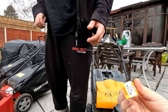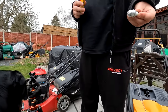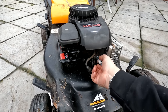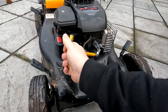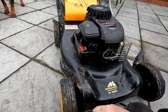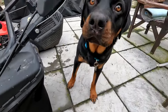B2LM — that's the one. They normally gap to about 28 to 30 thou, these. We're going to put this straight in. I'm anticipating this could fire up. Compress that washer and just a little nip up — that's all we need. Merlin the dog's eyeing up the tools on the floor — he's done that before, nicked sockets and run off with them. Now when he pulls it over, hopefully it'll be a lot easier.